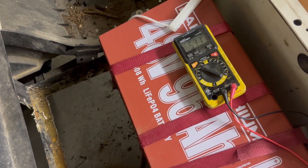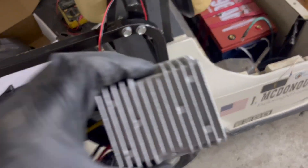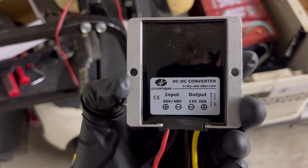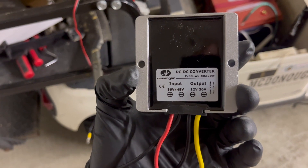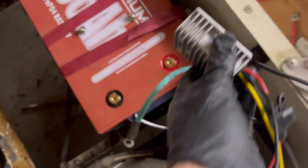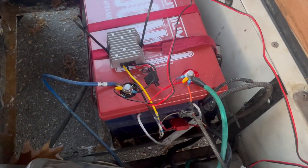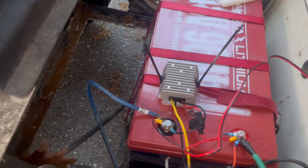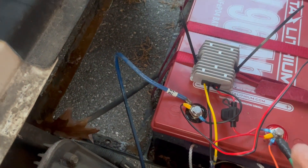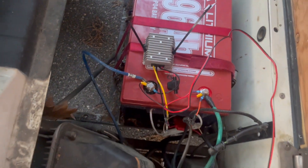This is our 48-volt to 12-volt converter — pretty straightforward, it accepts 36 or 48 volts and has two holes to mount it. I'll probably mount it here but not until after I build a more permanent floor, so I've got it sitting in there zip-tied in just so I can take it for a spin and make sure it all works first. This orange wire goes to the controller so it knows it's not being charged. The rest is straightforward and goes to the stock controller.